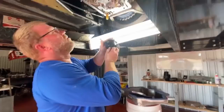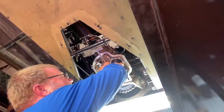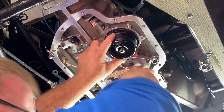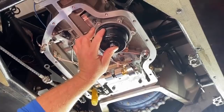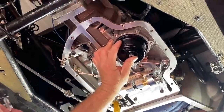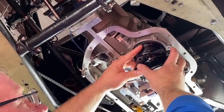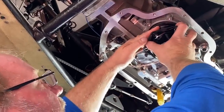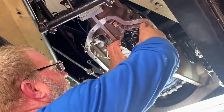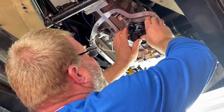So, servo — you can't see it up inside there but the band is right up inside there. When this goes in, that's what actually activates the band. That's the cool thing about his stuff being adjustable. The crew can actually adjust the bands instead of just guessing. That's all well and good unless the band starts losing adjustment or starts moving forward on the brake. If you don't have an adjustable one, it ain't gonna do you no good — you just have to pull it apart and try to shim it or put a new rod in it.